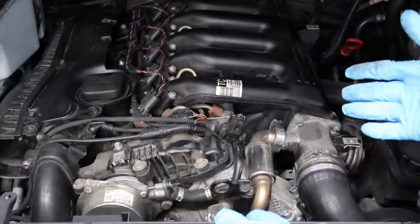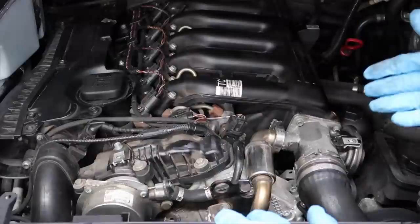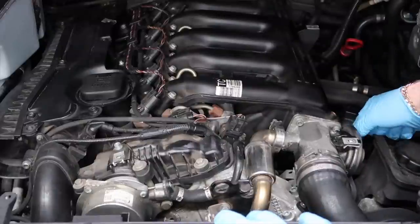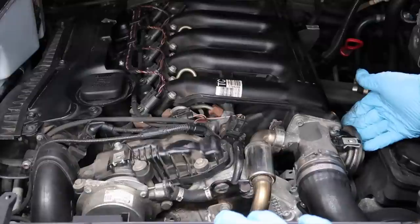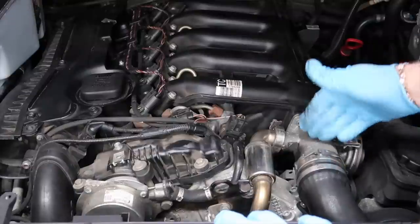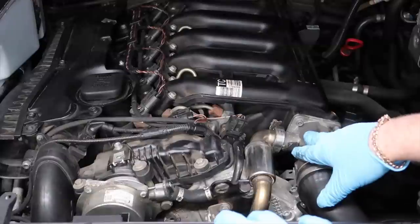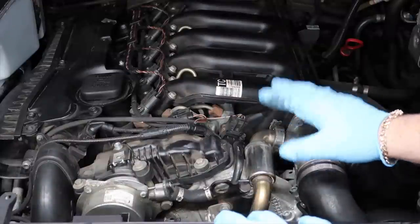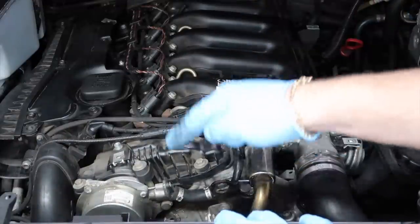I'm going to be removing it — I've always done it on my diesels. This doesn't cause the engine management light as many of you guys know, unlike the E60 where if you remove it it's going to trigger one. This model only has a vacuum system which we're going to be removing the vacuum line and plugging, and it doesn't have an electrical connector, so we don't have to worry about the engine management light coming on or having to map it out.